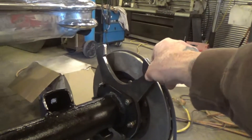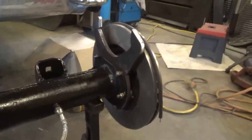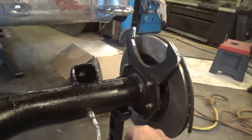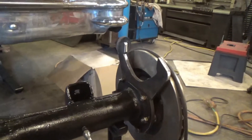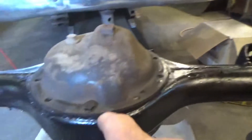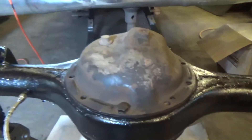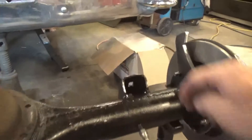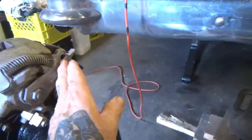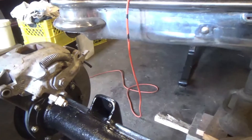Then I can take these off and paint them, rebuild the calipers, and they can all go together for good. Once those are threaded and these are painted I put them back on. I got all new bolts for here, all the same size. I'll tighten that all up and then I can put the rotors on and the axles in for good, put the locker in here and put the cover on. I also got to weld two little ears on down here for the emergency brake cable.